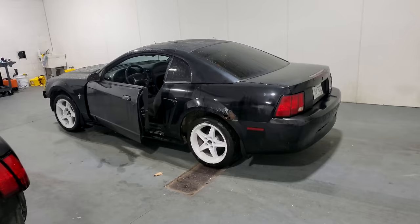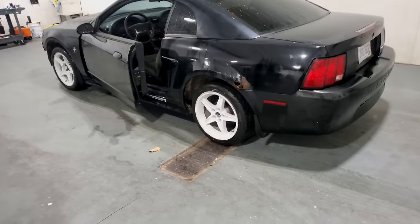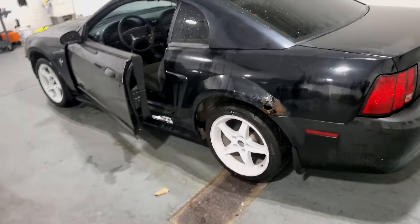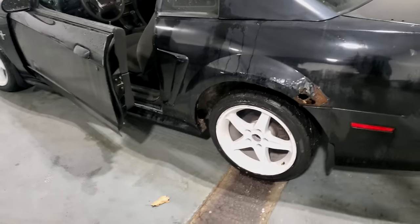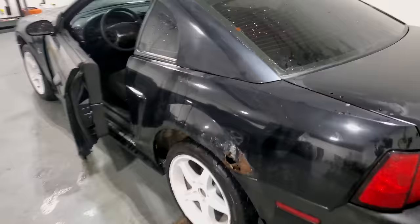Because if you're like me and you bought a $500 V6 Mustang and you want to go do some sideways drifting, there is one really important thing you need to address — the rear differential. Every V6 Mustang came with an open diff, which is a one-wheel peel. If you try getting sideways on pavement, you're just going to have a horrible time. Zero fun. So we've got to fix that today.